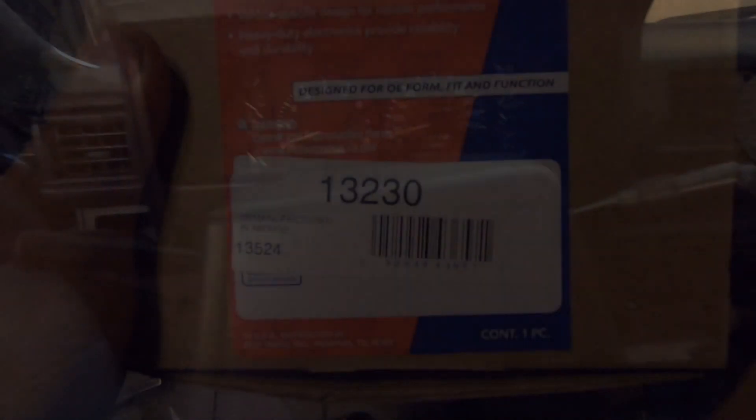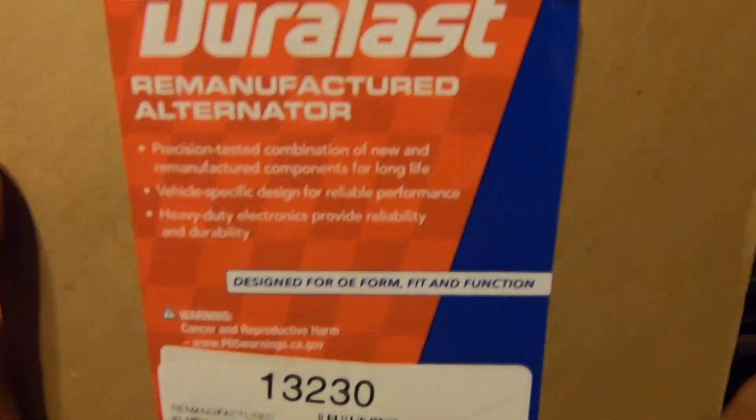We're not going to replace it with the stock alternator — we're going to replace it with a 120-amp alternator, which is kind of a budget upgrade for these trucks. The alternator is from a Jaguar XJ6 and it should be a direct bolt-in, except for the pulley — you have to switch over the 22RE pulley to the new alternator. Here's the part number; I'll show you the part.